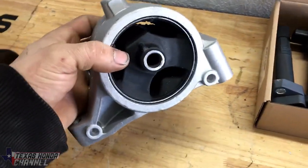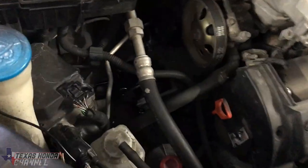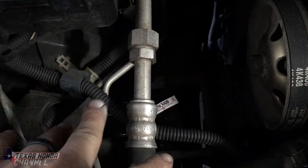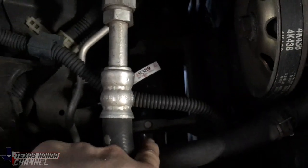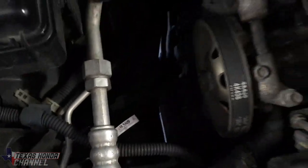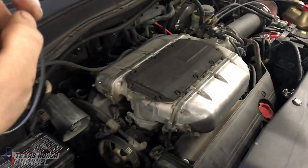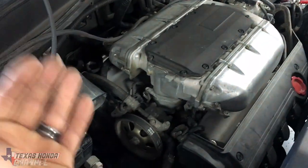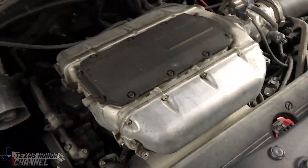I'm also going to be installing the rear engine mount. I already replaced the engine mount on this side — super easy, three 14mm bolts and one 17mm bolt that goes right through it. I supported the engine; I didn't get video of that, but I'm going to try to get video of the rear mount. It's a really tight space back there so I'll do my best to show you how to remove it.